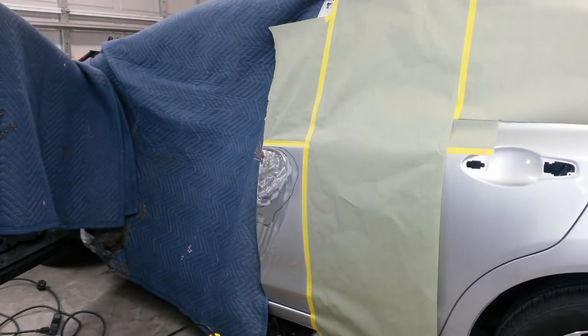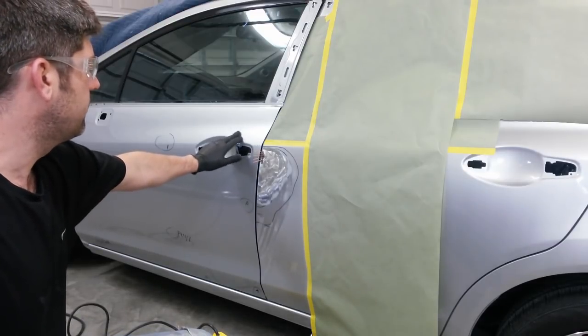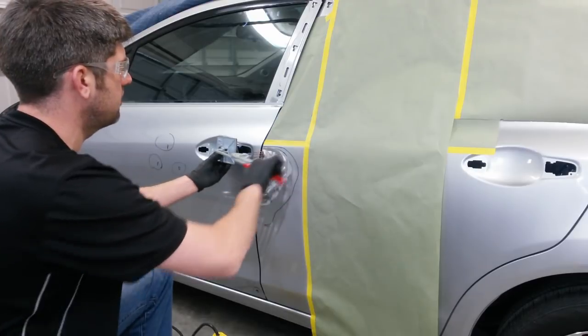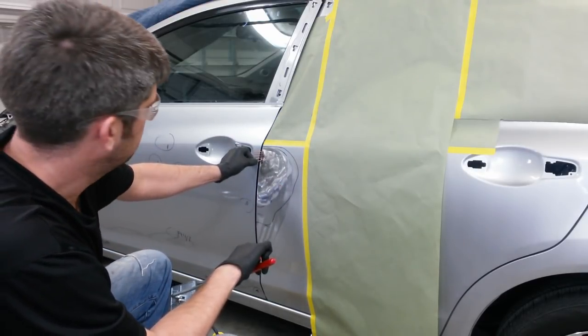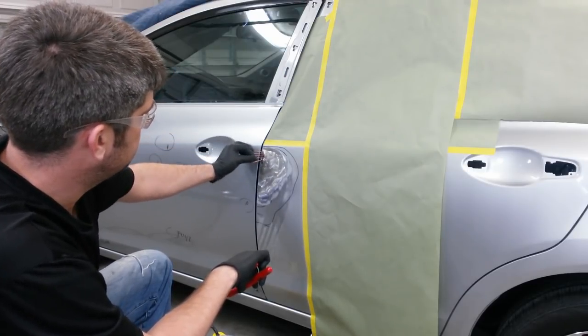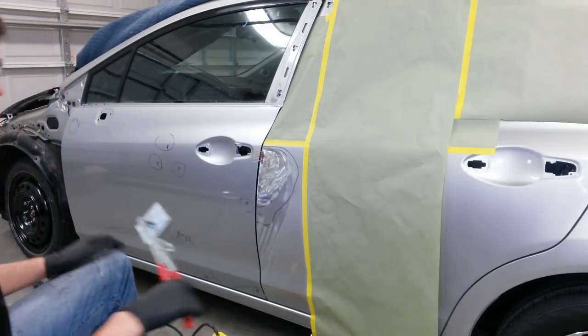Situated and start pulling. Be right back. I'm gonna start pulling. I'm gonna try to either use this stiff area of the front door or the back door, but I've got to be able to pull this direction so I can get more than one pin at a time. I'm gonna grab the bottom two, then the top two, and then the second and third one, then the second and third from the top, and work my way to the center that way.